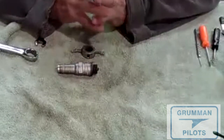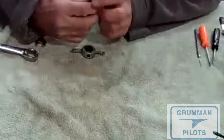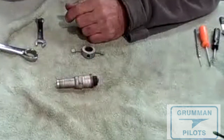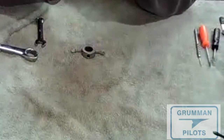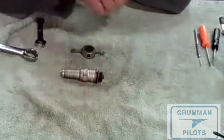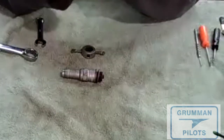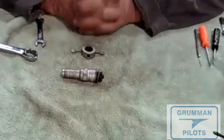Electronic ignition fires at 70,000 volts. We ran a little experiment with our first electronic ignition system: we took the plugs out of all the cylinders, put the plugs on the engine with ground leads, and pulled the prop through by hand. When the impulse coupler went off, we saw a little blue-green spark tick across the electrode — pink and blue, lasting maybe a millisecond, very quick. When we did the electronic ignition, what we saw was a quarter-second blue pipe-cleaner hanging up big and fat at 70,000 volts. That's the difference between the two, and why electronic ignitions are becoming so much more popular to replace one mag on our aircraft.